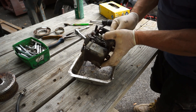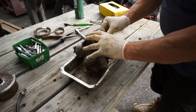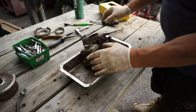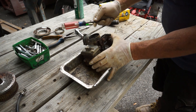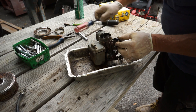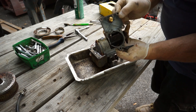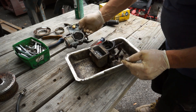I'm examining everything to make sure it'll come off without needing a full rebuild. Let's take this spring off — that's your linkage spring for the choke fast idle. I think everything I want off is off — five screws total. Let's tap it and it should come right up off of here, being careful not to damage that gasket. I'm liking it — you can see your main gasket and needle right there. I'm actually surprised how clean it is inside.